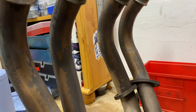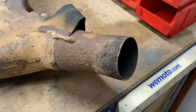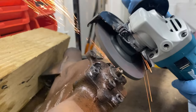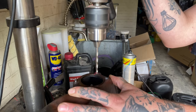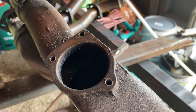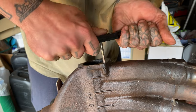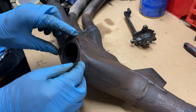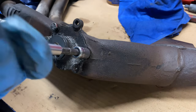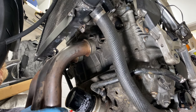The pipes had arrived and though they weren't in quite as good condition, they did have the correct size outlet for the bike. It also came with a bonus valve which had clearly seen better days, so the first job was to remove that. I had to drill out the studs with the help of my mate Ollie, then tapped in M6 threads. I transferred the good valve over and checked it all fit and that the valve moved freely. Then I put the cable bracket on before offering it up to the engine.